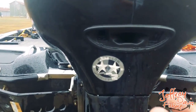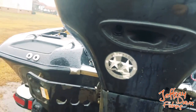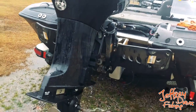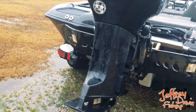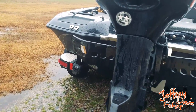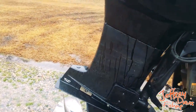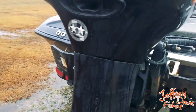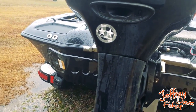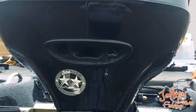So I took this cap off, took my hose, screwed it in here, and left it in there for about two and a half to three minutes — probably should have left it longer, just to make sure it got a good washout. But I was so excited thinking that fixed it, so I took the hose back, put the muff back on, cut it on, and it still wasn't quite there. The water wasn't quite bubbling out — it was very, very slow.